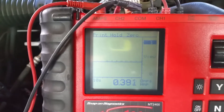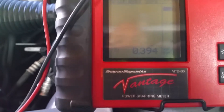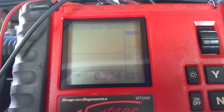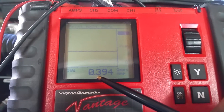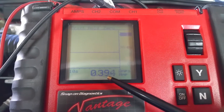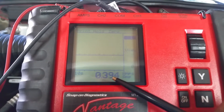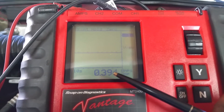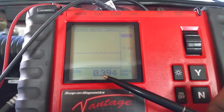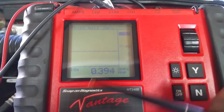We've got some sort of little pulsing going on there — I'm not sure what that's all about, but it's definitely seeing something. The main thing we want to notice right now is that we have way more of an amperage draw than the specs call for. Down here would be the same as a regular multimeter, so 0.38 to 0.39 amps is being drawn out of this battery. We want less than 0.050 amps — 0.020 is even better. I'm drawing about 0.3 amps more than I should be.